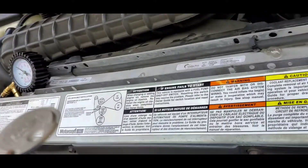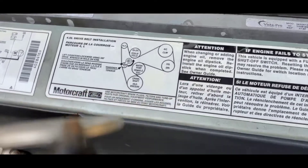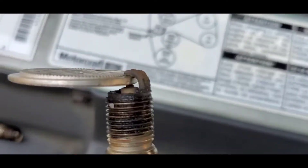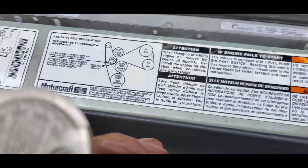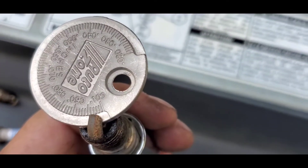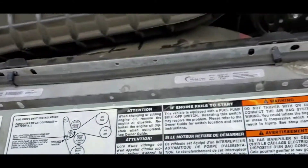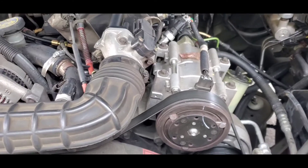This is the second plug on the passenger side from the front. Still flooded with fuel — still smells like fuel — and look at the gap: 95. Hopefully this is going to be our problem and once we fix the plugs the problem is going to be solved.